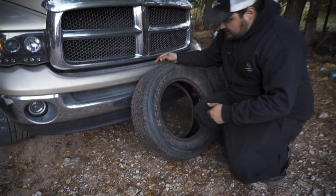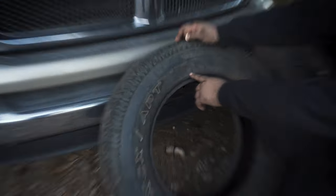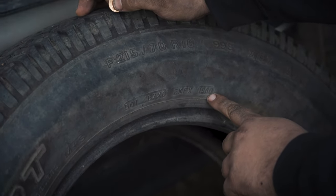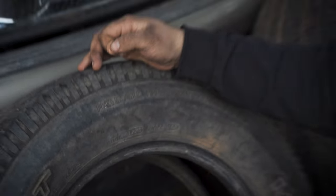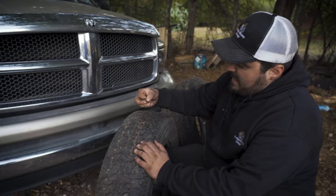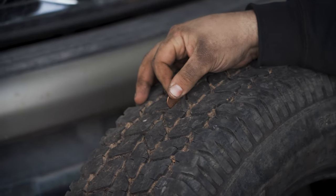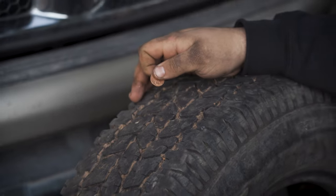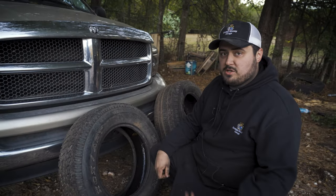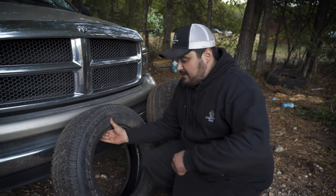Let's go to our next contestant. We find our tire date DOT code — it was made the 19th week of double-zero, meaning this tire is from the year 2000. Absolutely unsafe. But if you were just going by tread depth, Lincoln's head is completely submerged, so somebody could sell you this tire as like-new. If you didn't check the DOT number you'd buy it, and this tire is going to have a blowout. This tire also gets the failure.